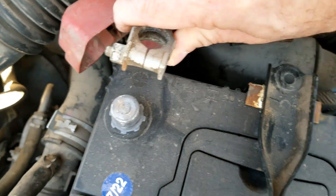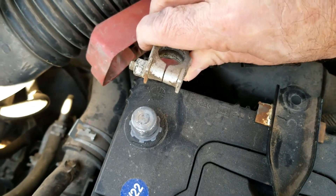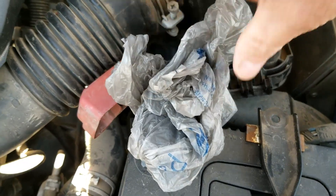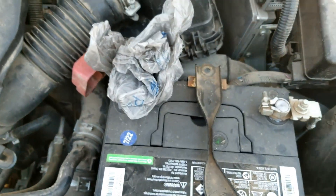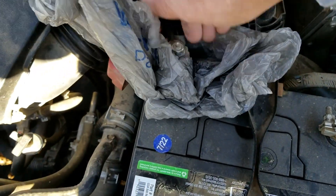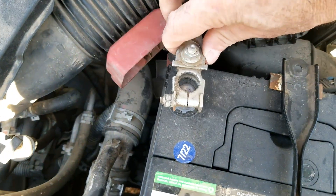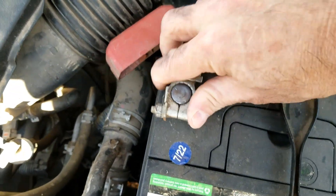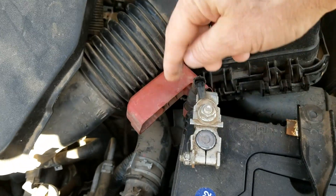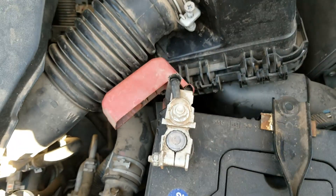I know this alternator is good so it shouldn't shut off. You can see it's disconnected — if the alternator was bad, the vehicle would shut down. Now this is the part where I don't like to reconnect it while the engine's still running. So I use my other hand to put the plastic bag on there, just like that. If the engine is running you'll see a spark jump if you put it back on, so it's best just to shut the engine off.